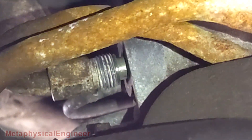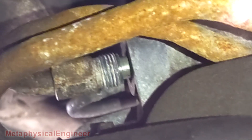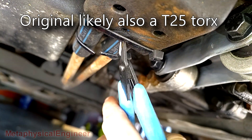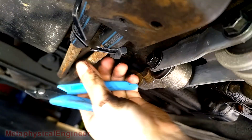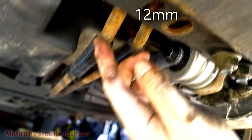Got the lock nut off. The o-ring is still in the bore and sealing, so I'm going to have to loosen the entire hose assembly in order for that to come off. T25 Torx for the line retainer, and cutting the zip ties holding them to the forward bracket. For good measure, remove the 12mm bolt and the forward line retainer just so I have a little bit more room to move them.